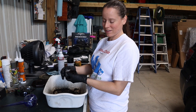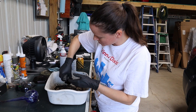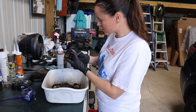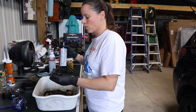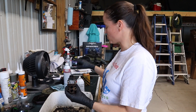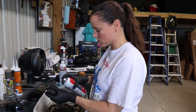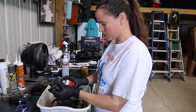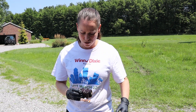We'll check back in in 20 to 30 minutes. And we're back. We've let this soak for about 20 to 30 minutes. I'm just going to dump out whatever Seafoam was in there. Visually, I can see a slight improvement on the internals. What we're going to do now is soak it in carburetor cleaner — this is mostly just to rinse out any of that Seafoam so we don't run into engine issues. Things are going to air dry while I prep everything else, and then we'll reinstall it, start her up, and see what happens.